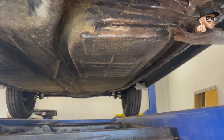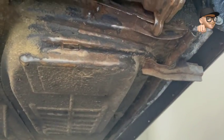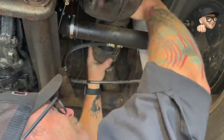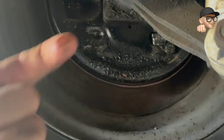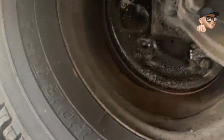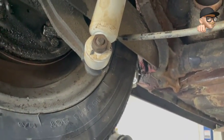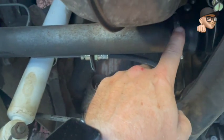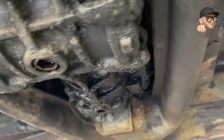I found a couple areas that need a little attention. These areas are always bad in these cars — it's a bunch of metal that gets pinched together and it's just a hot spot for rust. It's probably a good time to do the brakes too. We've got some oil-coated brakes which are less than safe, and this side doesn't look a whole lot better. They look like they have new backers but it's hard to tell — it could just be the seals are shot. These things actually contain oil, and this one here is leaking a little bit. We'll change up the brakes and may even switch this thing over to discs in the back — four wheel drums are not where it's at for stopping power.